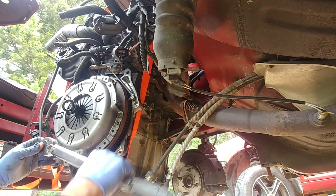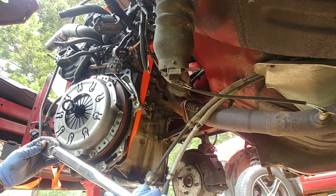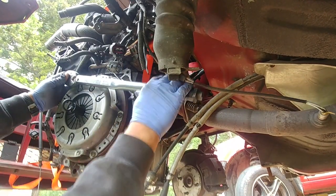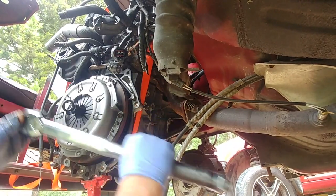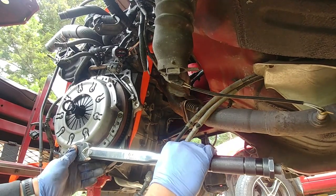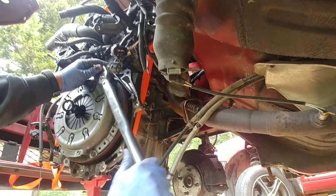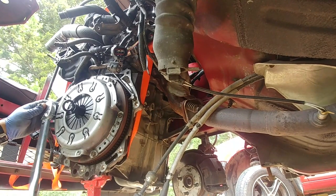I didn't really want to cut some of the clutch disc installation part because every single step is very important. It's taking longer, but then you make sure everything's going right and you don't need to do that job again. As you can see, following the order of tightening bolts is a very important part. Make sure pressure is applied to the spring evenly and just keep following and you will be good.